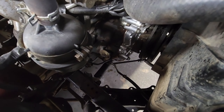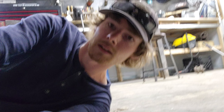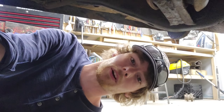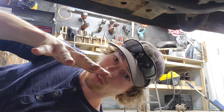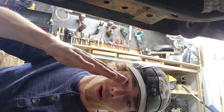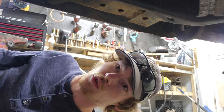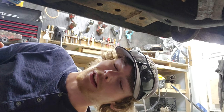The other problem that's going to be really hard to see is an oil leak. The thing about this oil leak is you have really bad camera angles, but also you can't really see it when the truck is parked level. I only find it because where I park in front of my house it's actually slightly sloped — it only leaks when parked angled to that one side. So in the shop I can't find the leak; it won't drip. But when I park it on the street, it pours out half its oil on the ground.